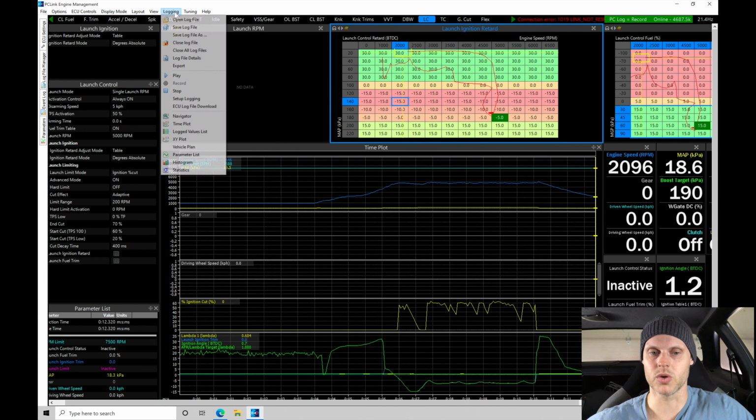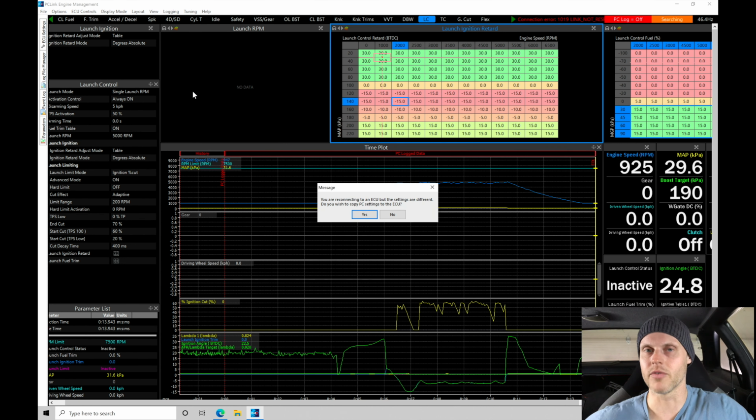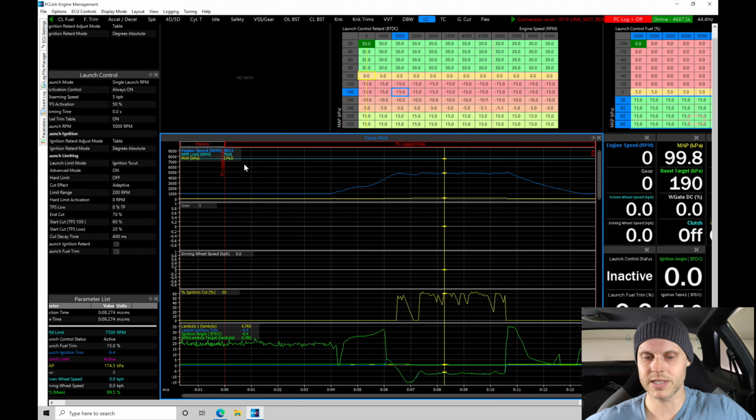That built boost much quicker, and we also can hear, let me stop it real quick, we'll talk about it. It was also going here and kind of hovering. You could hear it in the engine. It's hovering around that boost pressure we want it to run at, or getting closer to that. So let's look at this real quick. We can see here 170, 175.